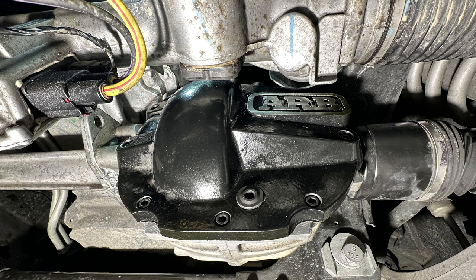Here is the completed product for the ARB front differential cover. This is the Ford 8.8 cover. It does fit, but it required some cutting — you're going to see that closer towards the end of the video. I wish I could have gotten the Spicer one. I think it would have been a direct fit, but after having it on back order for four months and trying multiple distributors, it just didn't end up happening. So I had to purchase the ARB and get this installed.